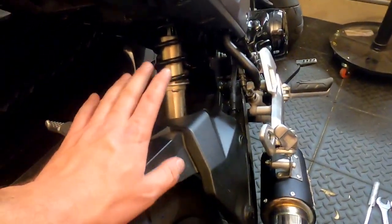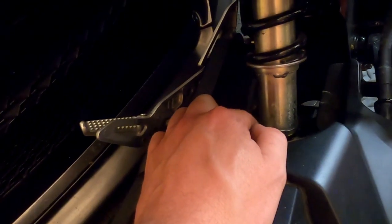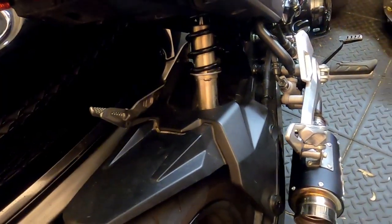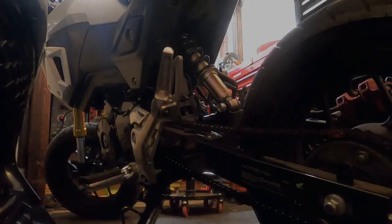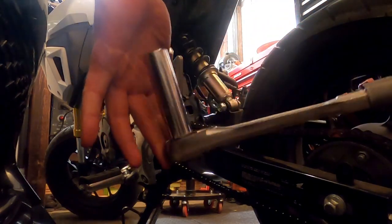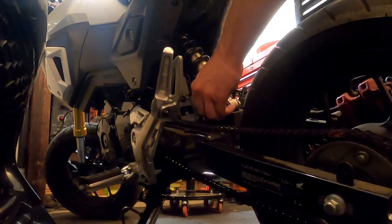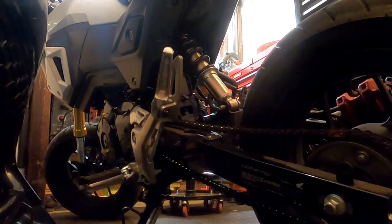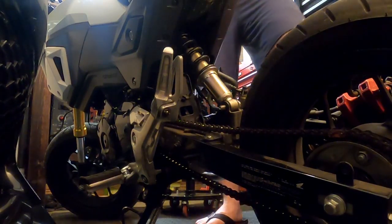So, let me finish getting this off, and I'm just going to break this loose. I'm not going to take it off yet, but I'm going to break this loose, and I'll bring you guys back when we actually go to doing all this. So if I drop it on my FRS, we'll all get to laugh at me together. Alright, so I actually used my cheater pipe, my half-inch drive with a 17 to get that broke loose. She's now broke loose. I'm going to pull the nut off and put it over here with the rest of my bolts. So, I'm going to grab this link itself.